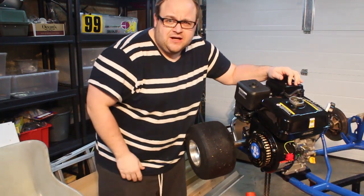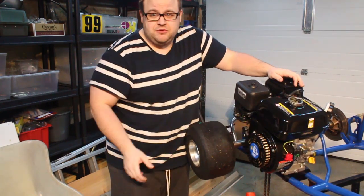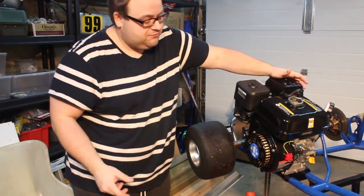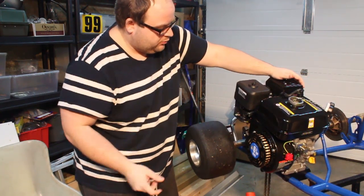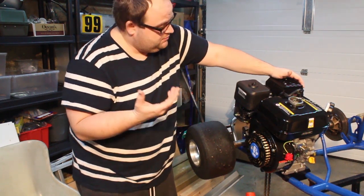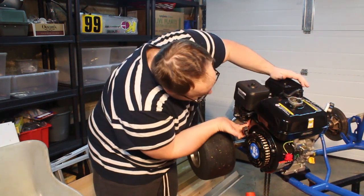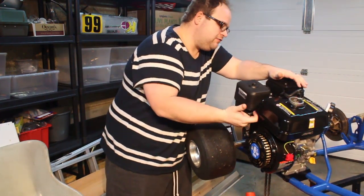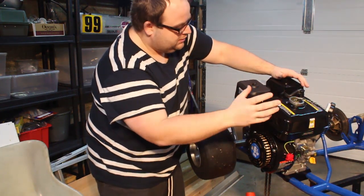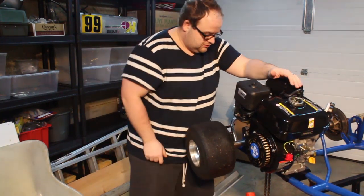Now, you recall last episode we fired this up and started it, so there is in fact fuel in the fuel tank. First thing we're going to want to do is get rid of that fuel. There are a number of ways you could possibly do that — you could siphon it out, which I'm going to avoid if at all possible. There's a linkage just to the carburetor and into that fuel pickup on the tank. As long as we can get the fuel below that pickup, removing the tank without creating much of a mess shouldn't be too difficult.